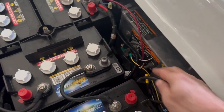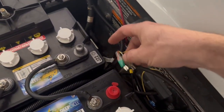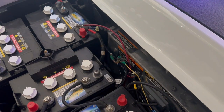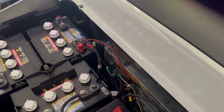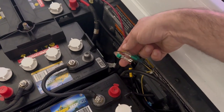I cut these guys out. So right now I don't have anything hooked up to red, which is supposed to be the brake setting, but I'm still getting brake lights. So it's getting that feed from when the lights go brighter via the signal, or either way, right? So I think that's what I'm going to try and do. I'm just going to jump it for now to see if it actually works.